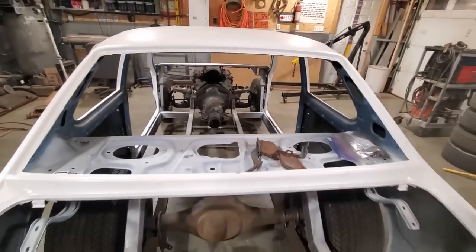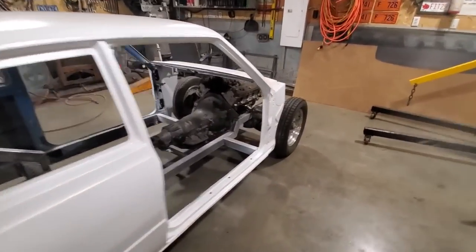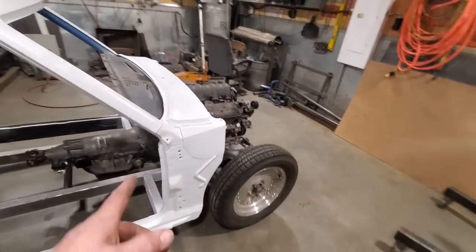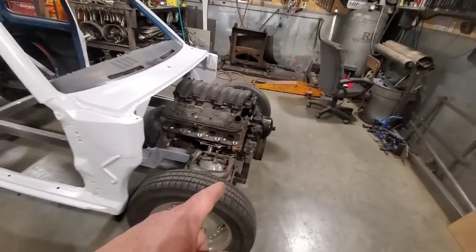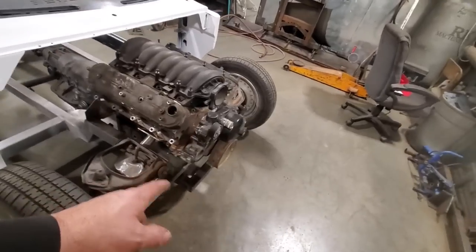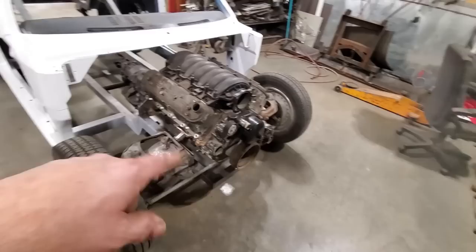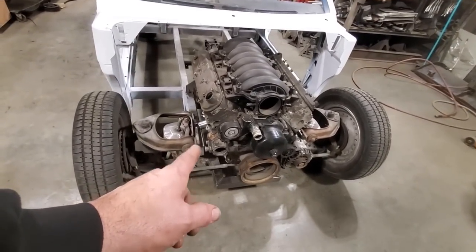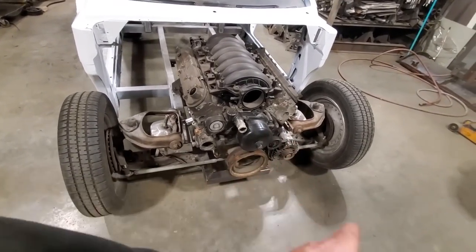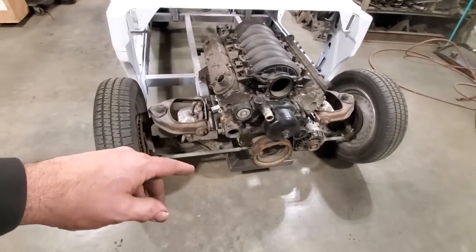So, next on the agenda is I'm going to have to start doing the roll cage. I got the engine mounted now, so I can start doing the loops and stuff like that. I got to extend the chassis out the front here. That's got to come out here in the front as well. I got to figure that out and bend up the pipes for that, because I'm already sizing it all up, because the radiator, I got to have it so that two of these come out and clear the sides of the radiator, because the radiator has to go down between the rails.